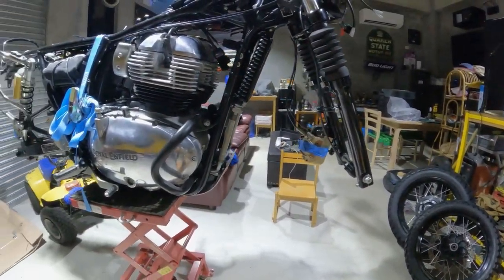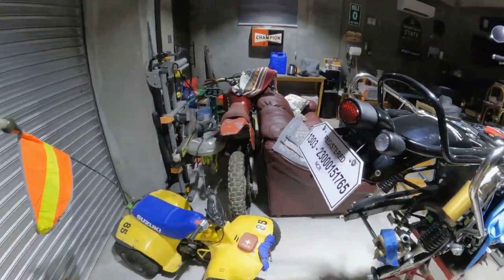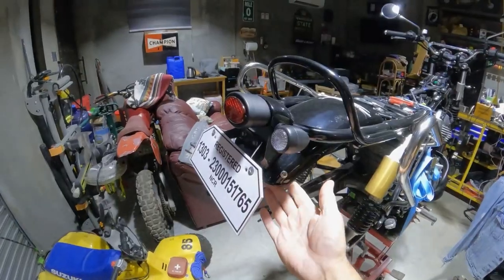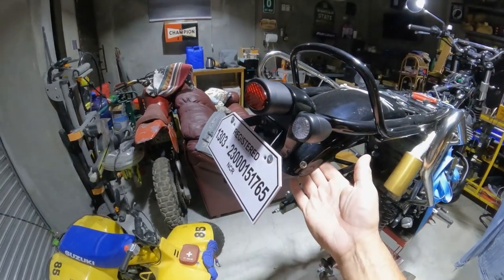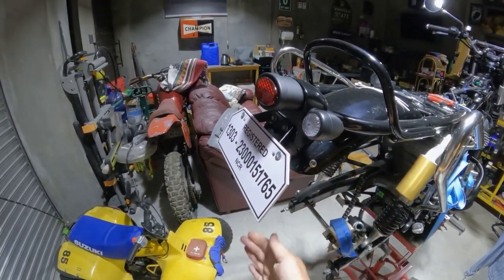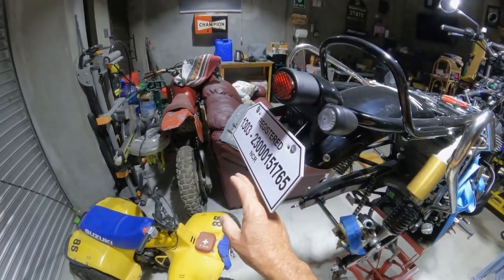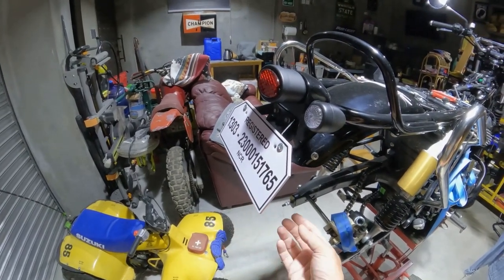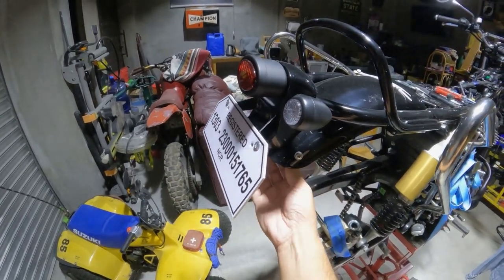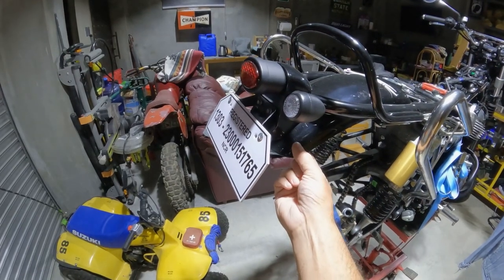Back on the turn signals — since I was on hold doing the front, I installed the rear. First thing I did was remove the secondary fender extension. It is practical but it's very ugly — it came down all the way and has a big ugly reflector on it. So I removed that, and then you have two holes where it hooks up, so I just put the bolts back in there to clean that up.